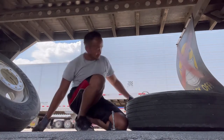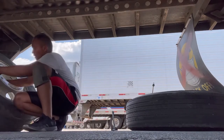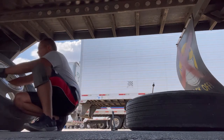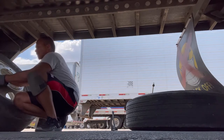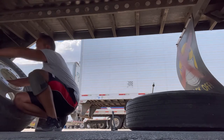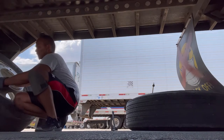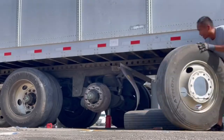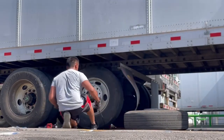Apply some anti-seize, because once you get towards the winter season, trying to get this removed might make it break. I did spray some rust penetrant on this beforehand so it came off pretty easily. After you have those removed, we're going to do the exact same thing with two pry bars — I found them at Walmart for about 10 to 15 bucks a piece.